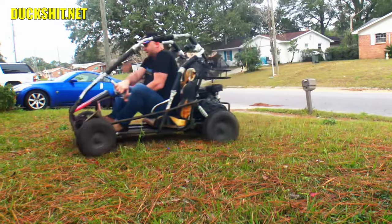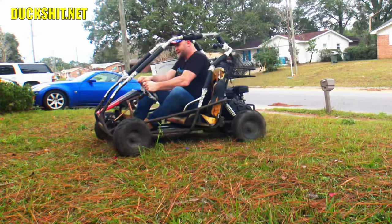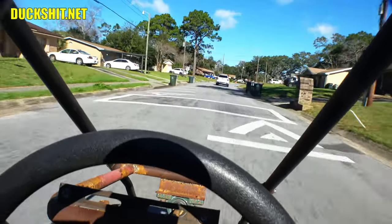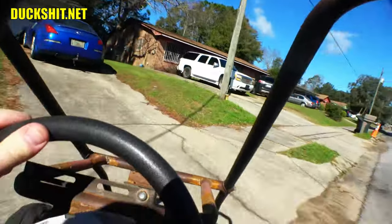The turning radius is really wide at low speed. Throttling up and lifting the rear wheel with a solid rear axle makes a huge difference, but the front wheels are still fighting with each other. Sometimes they suddenly change which one grips, or sometimes neither. You can get some very unpredictable snapping of steering, and this does not give the driver any confidence.